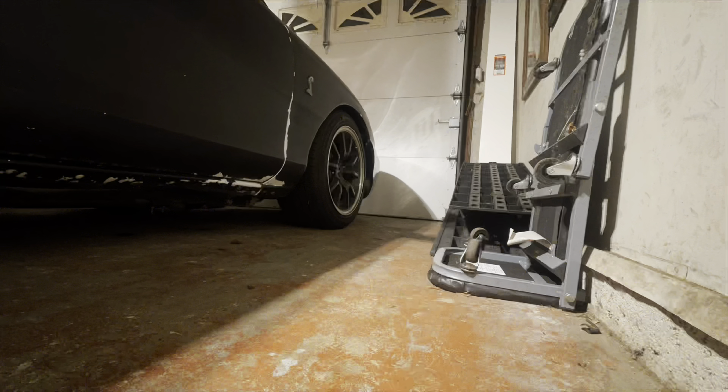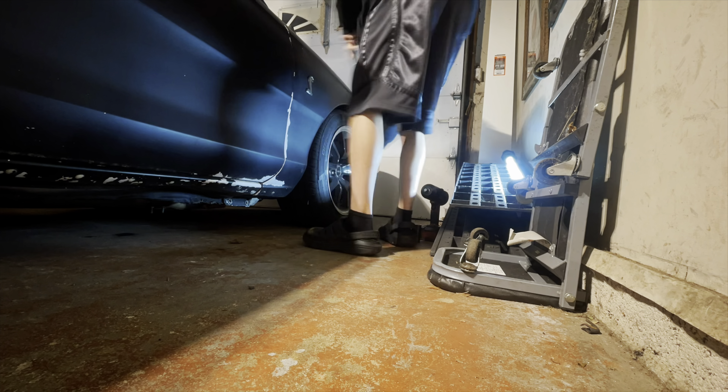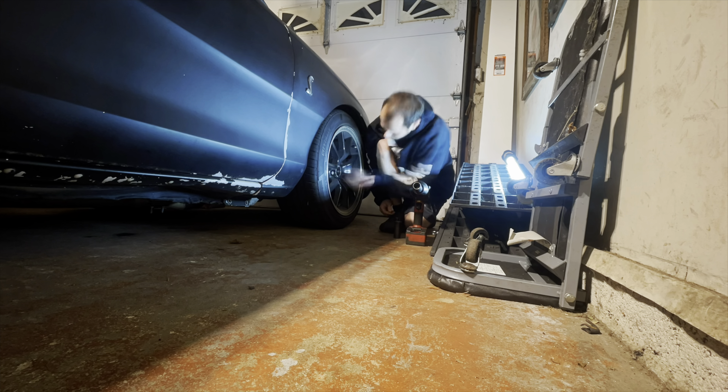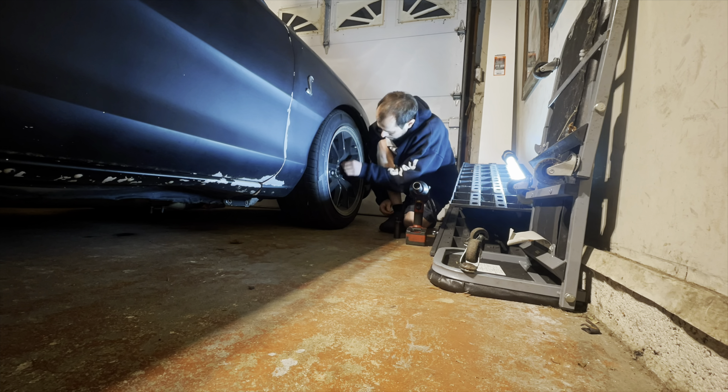I also have the factory size speedometer gear, so I'm going to get that tossed in. The reason for that is we need to run a speed cal on this car because we are going with a much steeper gear than what is in the car right now. Then I'll get it jacked up, get the wheels off, and I'll take a look and see if I want to pull the rear or not.